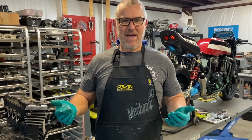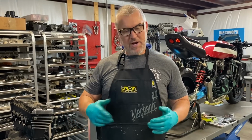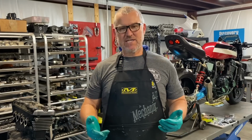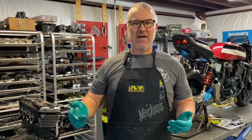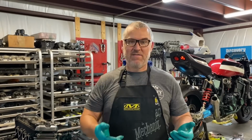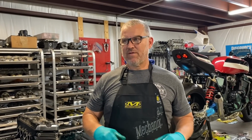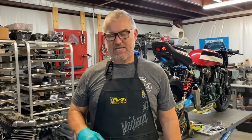Even though I've never had any problems, and none of my customers have ever had a problem running them open, there is a chance that you could ingest something large that could chip a valve or a valve seat, or even bend a valve if the piston came up at just the right time. 30 years of experience, never happened. We've got hundreds of thousands of miles between myself and all of our customers running them this way, and it just doesn't seem to be an issue.